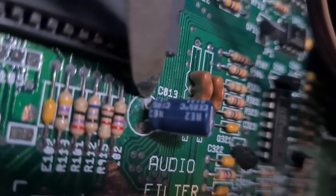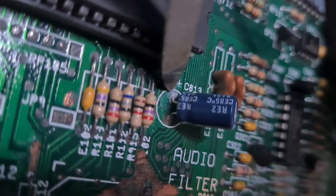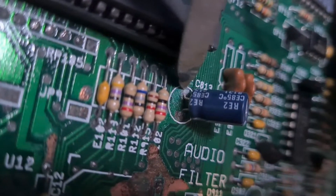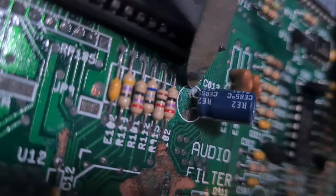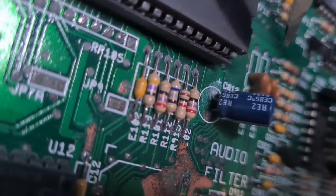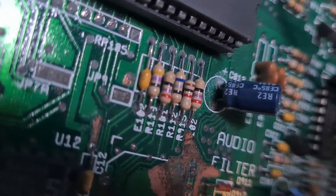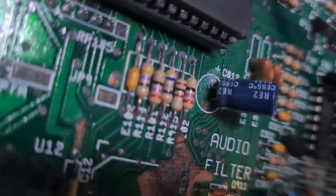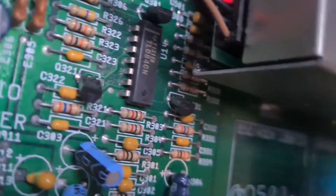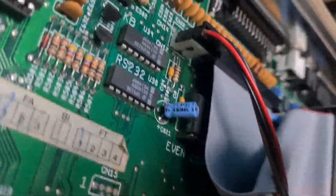You can see it was just around the solder there — this pad that's come away. I'm just going to have to sort this bit out real quick, sorry about the shaky vision, I'm having to hold the camera. It's actually helping me use it as a zoom to scratch this off. I'm just going to dip a bit of vinegar on and leave that. I may just have a close inspection everywhere to make sure I didn't miss any — it was the tiniest of spots on the leg of that cap, but it needs getting rid of everywhere. I'm going to have a quick go over just to see if anything needs doing before we move on.